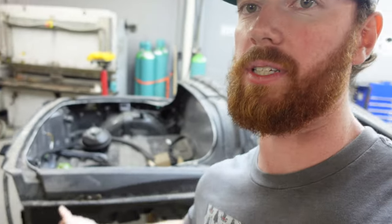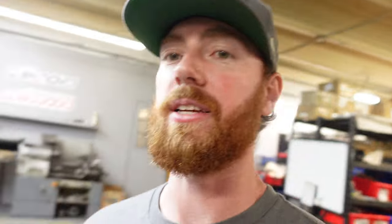I'll tack it in place. I might also do the base plates for the roll cage because that's easy, and I need to remove this entire fiberglass rear. But before I do that, I'm going to be 3D scanning the entire rear so that I can find all of the mounting points for the fenders, and I can make a steel structure that's going to be in the exact same position as where the fiberglass was. The easiest way to do that is to scan it while it's there so that I know exactly where it needs to be. So when I design it on my computer, I can recreate it and install it, and I know the fenders are going to sit exactly where they should be.